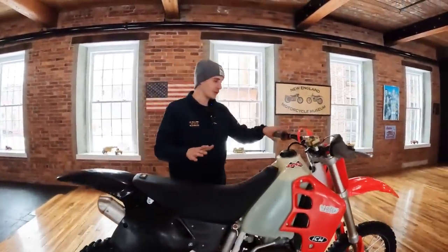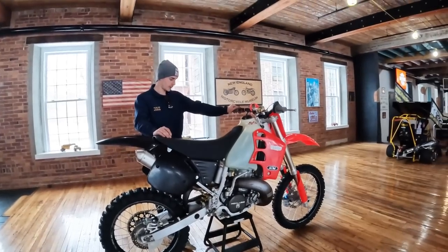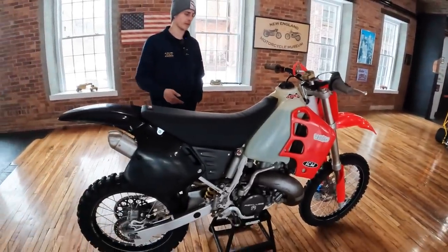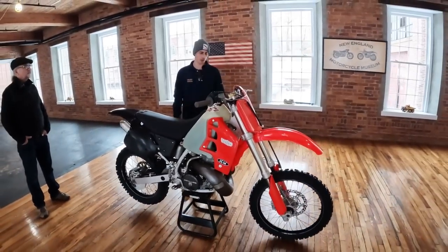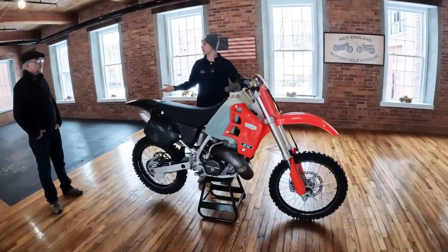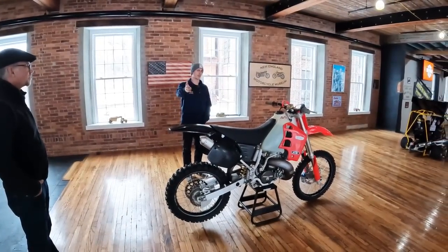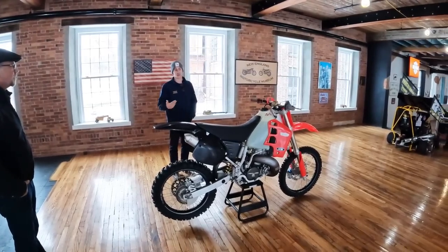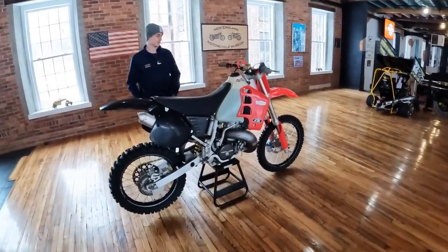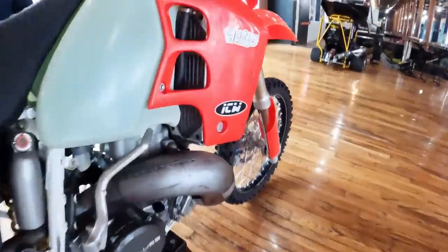We've got to combat the heat. I looked into whether MSV makes a super cooler kit, but unfortunately they don't have one for this bike. So I have to look into further options. What did you do with the radiators? That's Brett from ICW down in North Carolina — outstanding work. They're still stock size, not oversized, but they're caged and braced. That saves you if you crash — anybody who knows Hondas knows these bend like paper. A bent radiator is a DNF, and not a lot of people at a 500-mile desert race are going to have a CR500 radiator on hand.